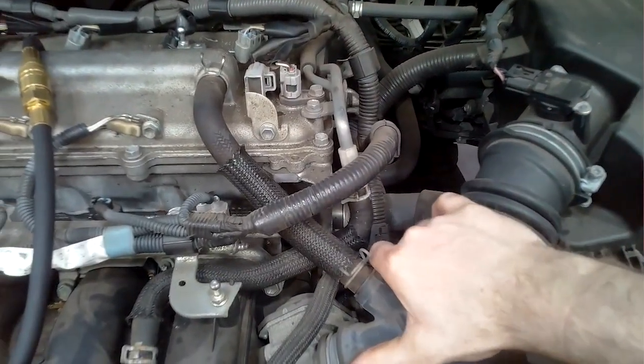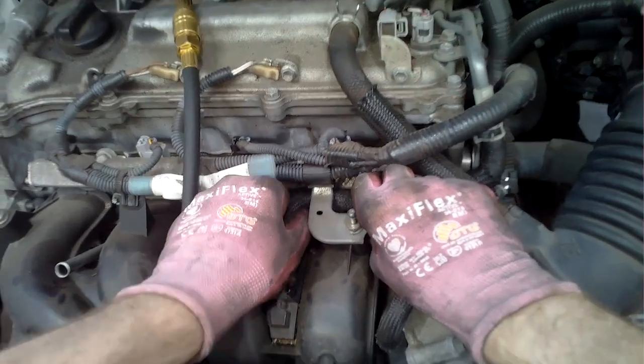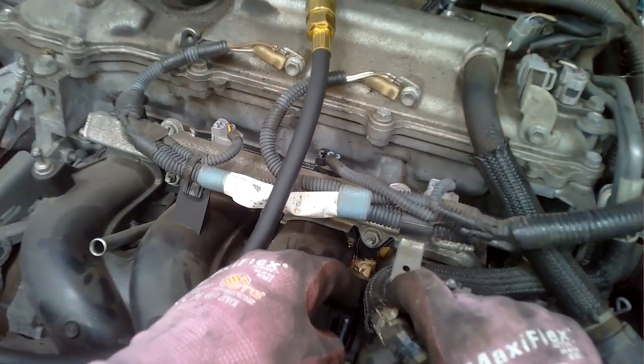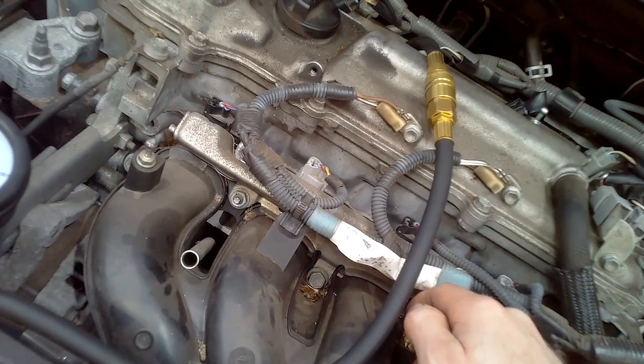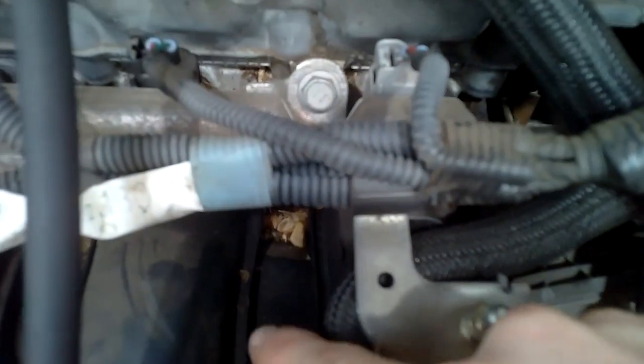Lastly are the valves. By doing your checks you can see which one — intake or exhaust — is faulty. In this case I took a pipe off the intake manifold and I was able to hear air passing through, which you can see here. That gave me a complete understanding that the intake valve was not seating correctly on the cylinder head.